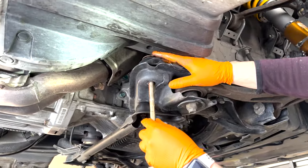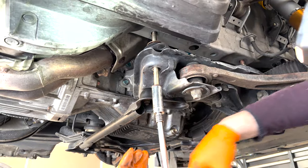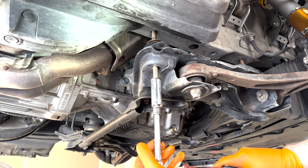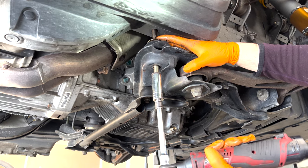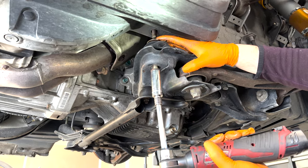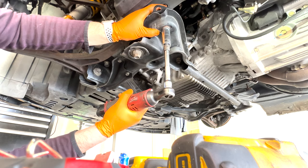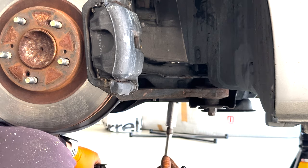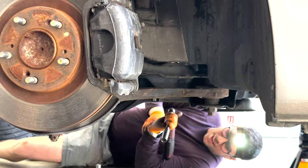It's also important to mention that there are two different sized collars in the kit. Be sure to reference the Spoon diagram to make sure you're using the proper ones for each section. For the remaining bolts in the front subframe you'll go one by one, backing out one bolt at a time, being sure to apply copper grease to the collar and the bolt before threading it back into place. It's important to take your time making sure you're using the right collar in the right position and hand thread before using power tools. The last thing you want to do is strip the threads in the frame or break a bolt.